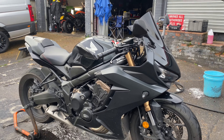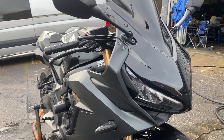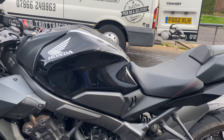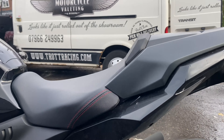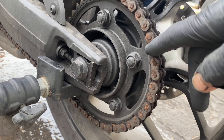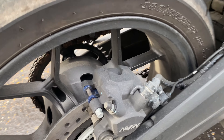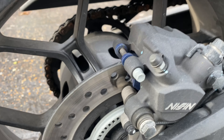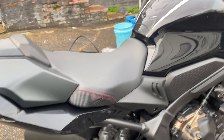Good morning — first one of the day. This is a new client with his recently acquired Honda CBR 650. This gentleman is going to take advantage of our half-price ceramic addition to a full monte valet. This is going to get a whole dose of love — it's already looking a little sad. We'll get all this old rusty chain lube off, blow dry it, and get some fresh lube on. See these banjo bolts — see how they're turning all white? That's corrosion, so that's why we always put the XCP orange on bits and pieces like this.